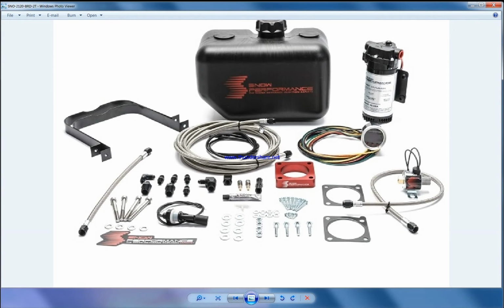And see, they started using nylon tubes because we had issues with the plastic tubing. It normally gets hardened because of the temperature inside that engine room, and it starts leaking. Nowadays all the kits use AN fittings and steel tubing. It never gets damaged and has a long life.